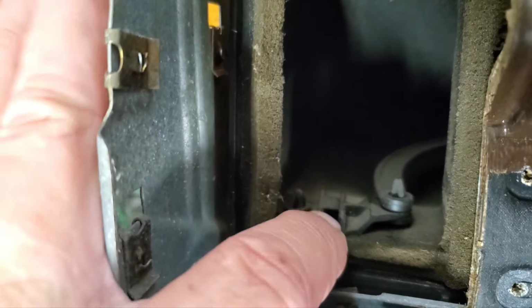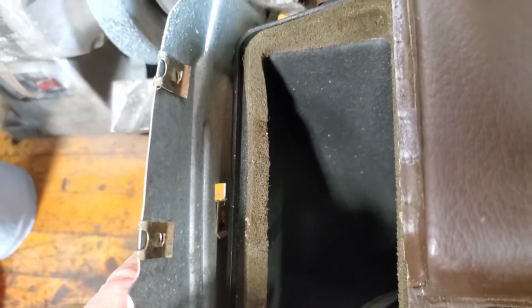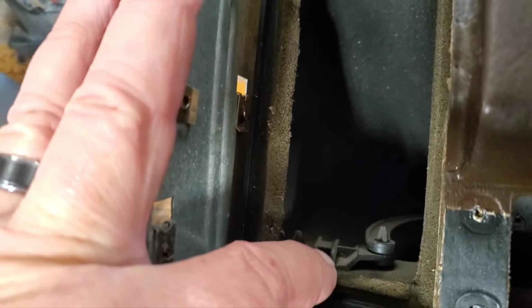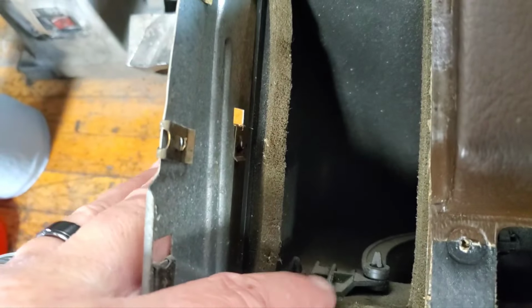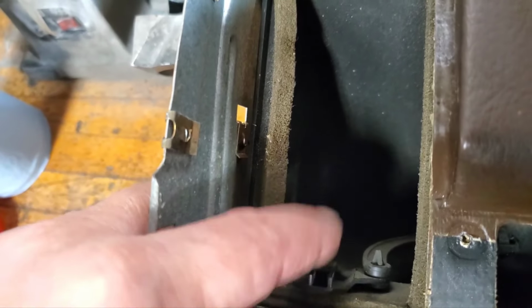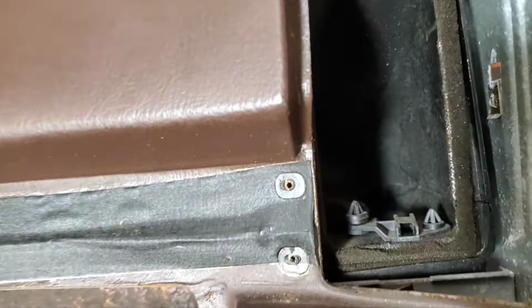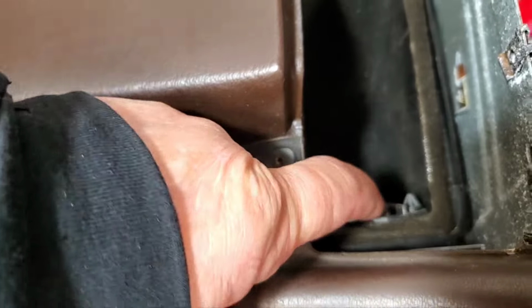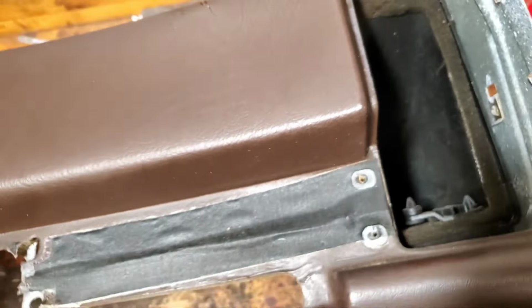And what's happened when you stick the vent itself with the vanes in here, there'll be a little plastic tab that'll mesh up in that opening there. And that's how that works there. So you want to check that before you get it in the car. And if you need to swap some parts around or whatever, now's your chance.